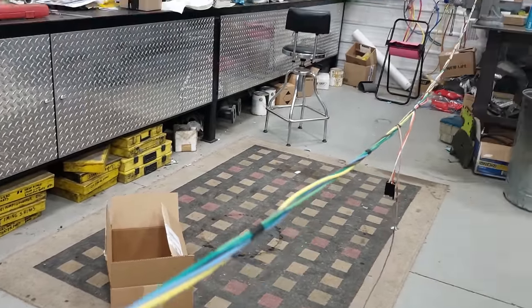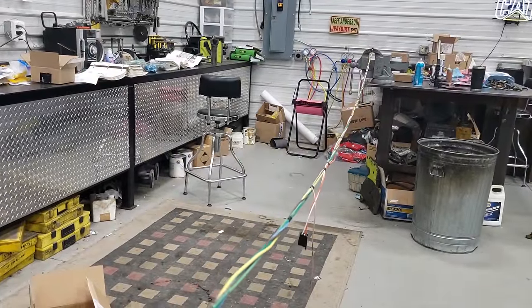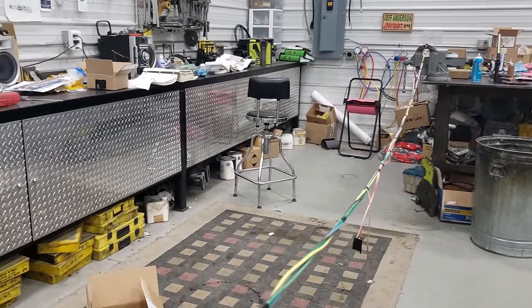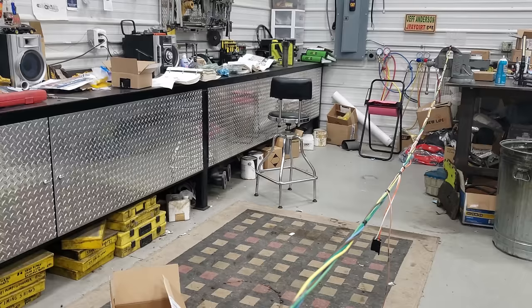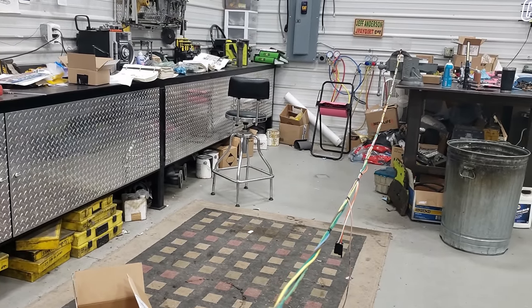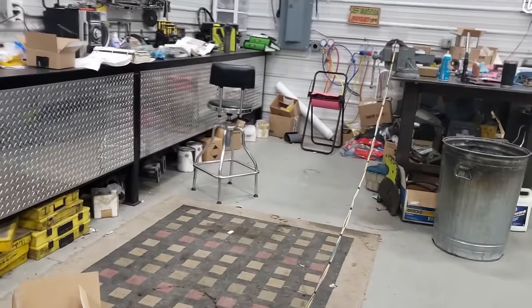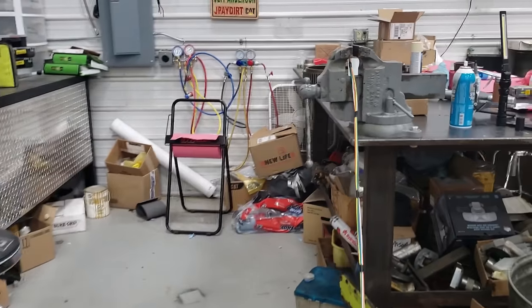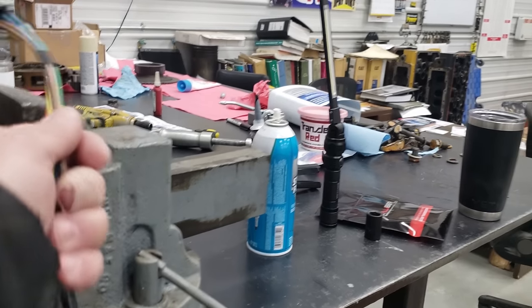So I need to go get some speaker wire to go with this too. I'll have to ask the stereo guy if I can run those speaker wires in with this, or I need to separate them. Don't know if that would cause any electrical interference, buzzing in the speakers or not. But anyway, that's quite a chunk of wire, so it's going to be hard to fish around in there if you don't tape it up every foot or so.